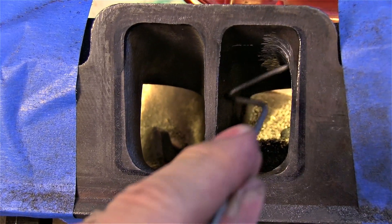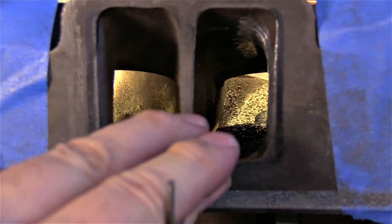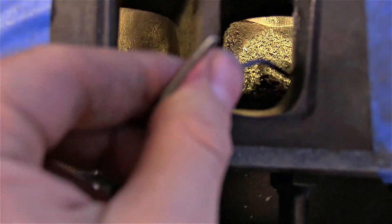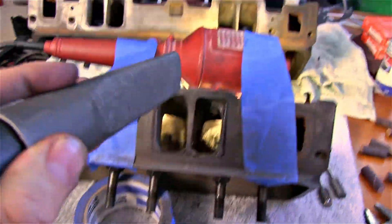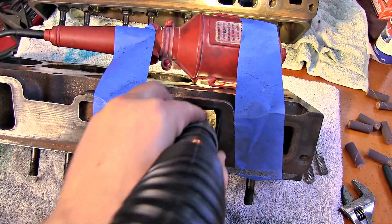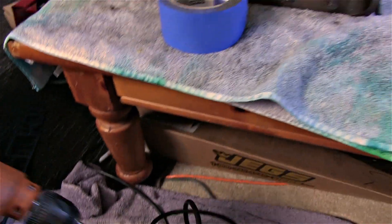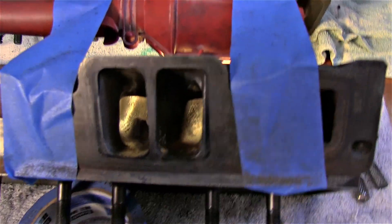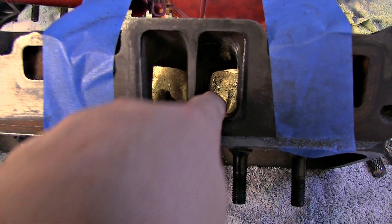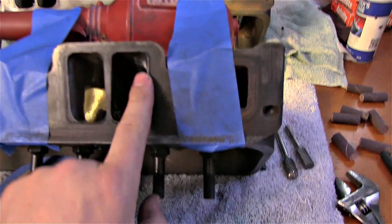He's going to get good gains out of this. Next we're going to work our way into the intake port — look at all that material that's been removed already. I'm going to vacuum that up, then put the larger carbide bit on the die grinder and open up this side and blend back. Later on I'll switch back to the drill and I'll explain why.